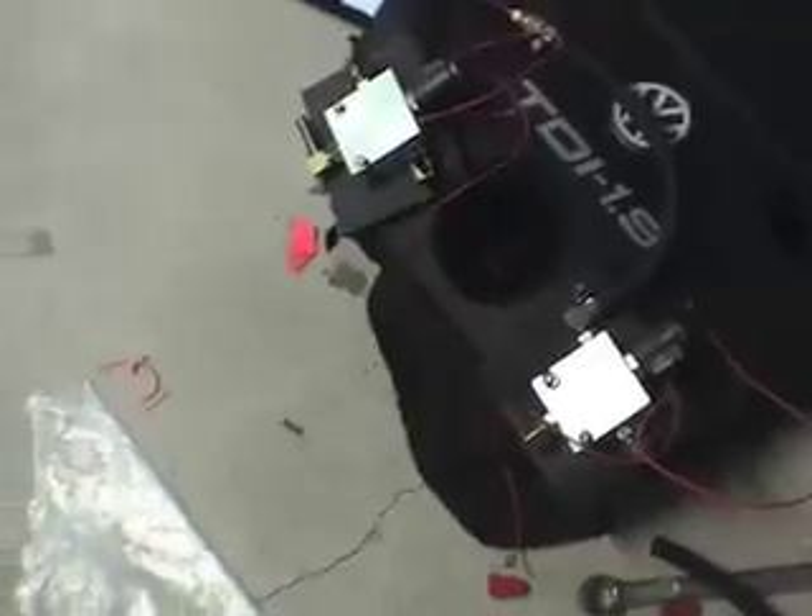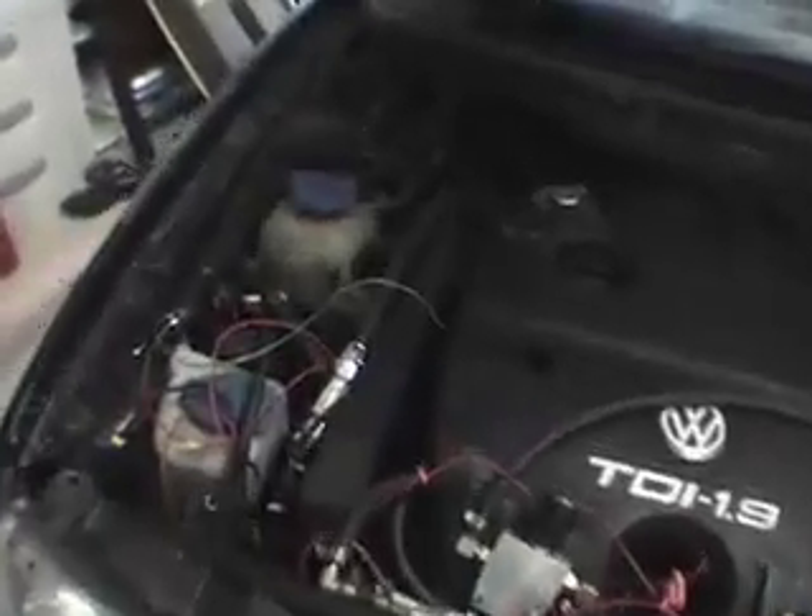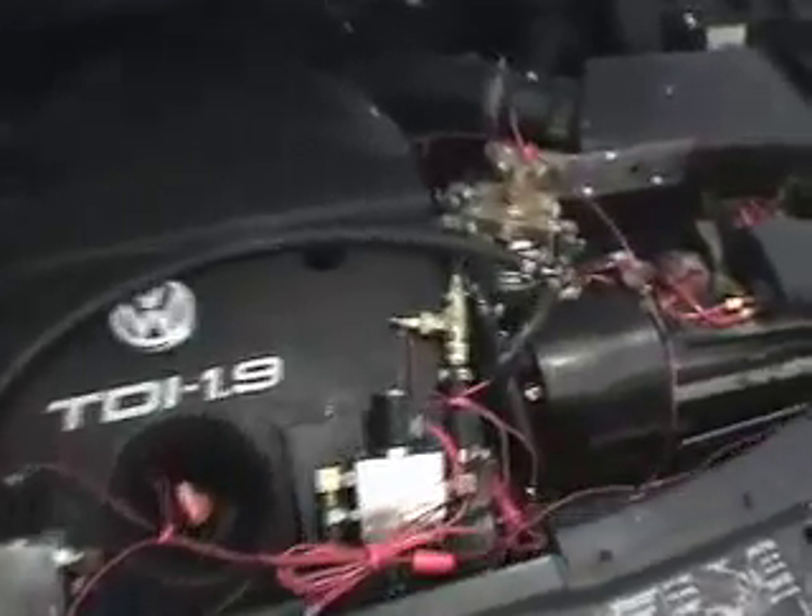Here's my mess of workings. Here's the cowling with the three-port valves on it — two three-ports plus a third three-port for the purge system — and some neoprene for insulation. I'll probably cover it in neoprene to keep the heat in. I've put the thing back together and did start the car. It starts on diesel — by default, if everything is turned off, it runs on diesel. I haven't gotten hot enough for the thermostat to kick in to check for water leaks. The only concern is some of my flare fittings. Here are the two solenoids, two three-ports, and there's another three-port down there in a bed of foam. Fuel in, fuel type out, and this is the purge — depending on what position the switch is in, it will purge to the diesel tank or to the veggie tank.